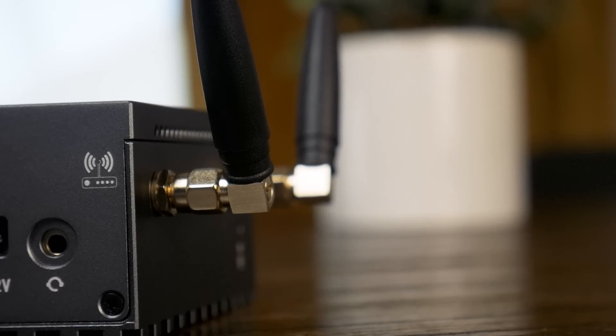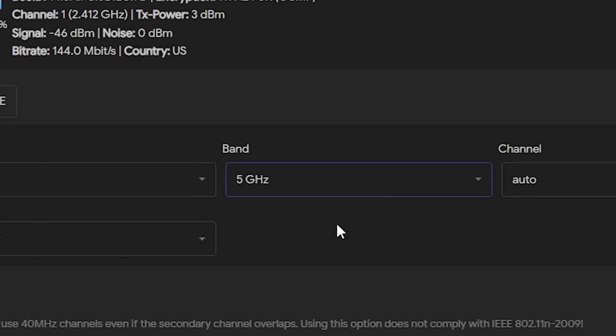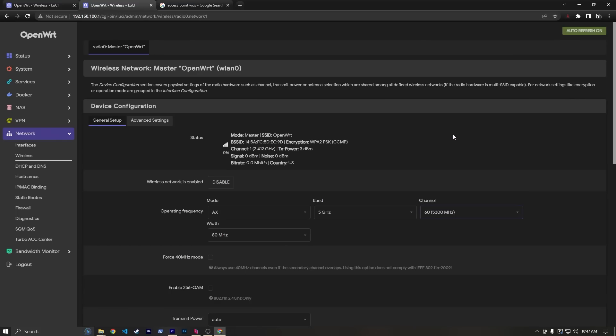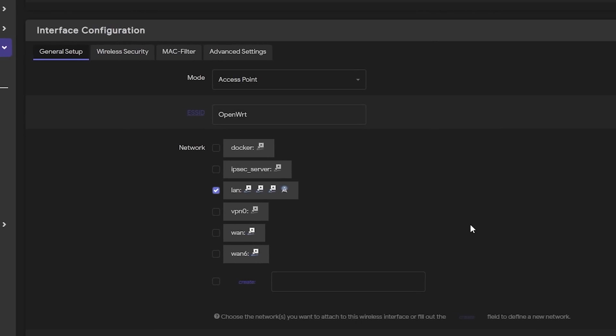I was really curious about the built-in Wi-Fi, so I decided to get that up and working first. Setting up a wireless network was pretty easy, but I was disappointed to see really slow speeds when testing with my phone. After tinkering for a bit, I realized that I was only on the 2.4GHz band, even after manually selecting the 5GHz band. The only way I found to fix this was by manually selecting a channel rather than selecting auto, and after that things looked normal. Having to manually select a channel is a bit less than ideal, though. I'm far from being an expert when it comes to Wi-Fi, so it's more than possible that I missed something obvious — if so, let me know in the comments.